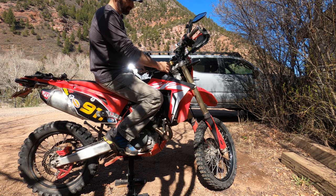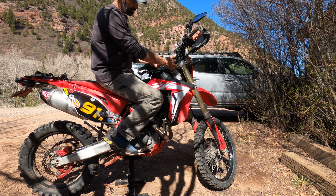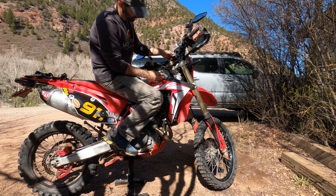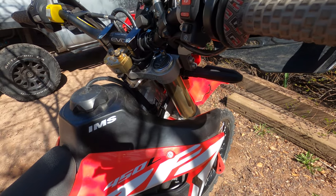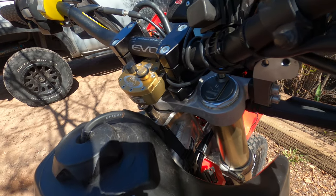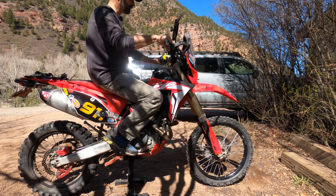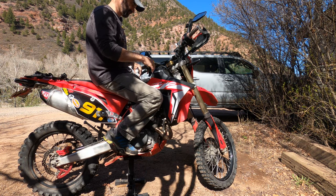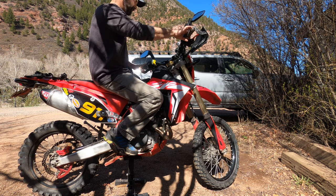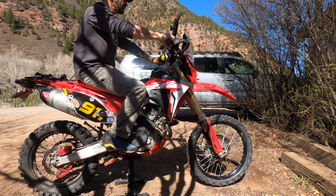When I got the Scotts steering damper for the sub-mount so it would go underneath and out of the way, they automatically give you risers — probably a good two inches or close to it. Ever since I put that on, whenever I'm in the dirt I just don't feel quite as connected to the bike as I'd like. Standing up, it's awesome; sitting down riding feels pretty good — but where I care about control is where it feels off.